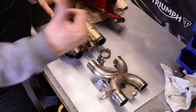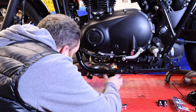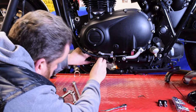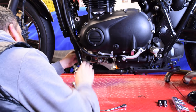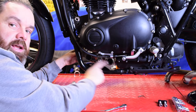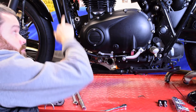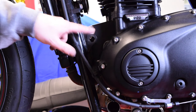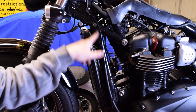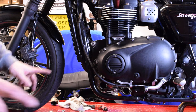This is all ready to go now. It's a case of getting that rubber bung in place, pushing that into the other side, and once this is pushed on and lined up, just nip these two bolts in. Once they are in, we know the X-pipe is in exactly the right place. I'll go through the torque settings because these bolts will need to be torqued back up: this larger bolt needs to be tightened to 80 Newton metres and the bolt at the top — same as the side stand — 45 Newton metres. All the frame rails have now been tightened and torqued up, and the rad can go back on. Reconnect the side stand switch.